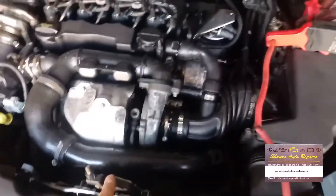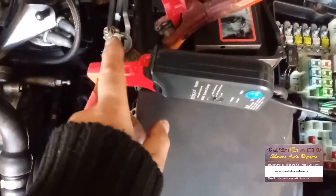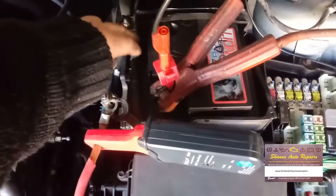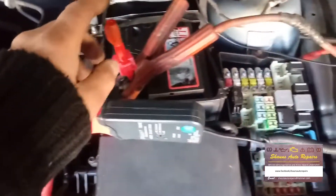I've just turned the car around to give me a bit more access to the fuse box which is down under the footwell. The keys are out, I've latched the door so the door thinks it's shut. Coming around to the front, I've latched the bonnet so the bonnet thinks it's shut. I've disconnected the positive cable on the battery and put a big jumper cable — like half a jump lead — in between, so I can stick my amp clamp on there from the Pico. There's not enough room to get it onto the terminal itself, and I find it a bit unreliable putting it on the earth wires, since you've got two — an engine earth and a body earth. So I've taken the positive off and put this on there.